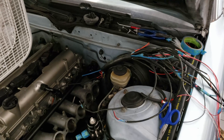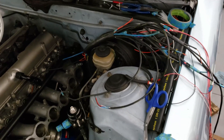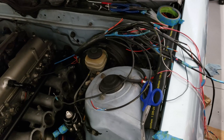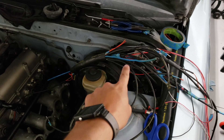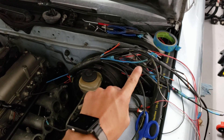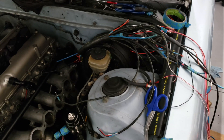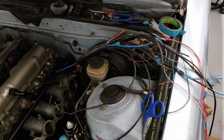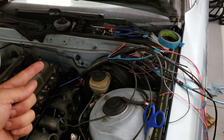I got my DR-25 and it's looking like it's working. It's still a big pain but it's gonna fit. I'm using a blue wire as a tracer to get it through. It was still a pain - just take it from me, make sure you have your DR-25 on the main part of your harness so you can work it forward.